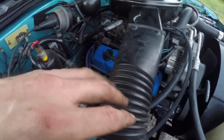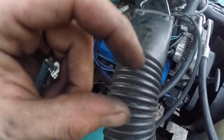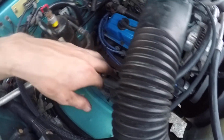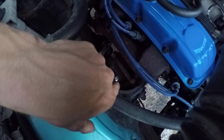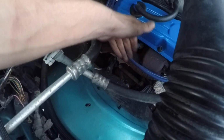When you tighten them down, I usually just tighten them down until the rubber stops, or the rubber basically seals, and then the strut will actually spin itself. Like the whole strut assembly will actually spin. You can use a wrench and hold the top of it to torque it all the way down, but usually if you just do that, they hold themselves in place. Especially these ones have a double nut setup, which the top one sets it and the bottom one sets it, and the top one locks the bottom nut in place so it can't move. Realistically, that's pretty much all you got to really do with that.